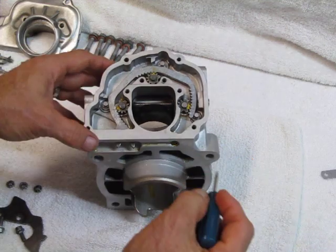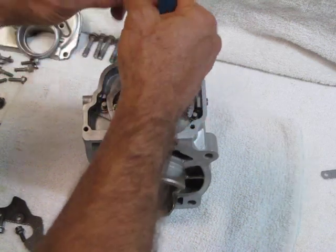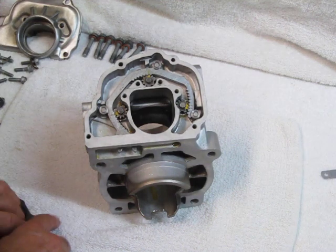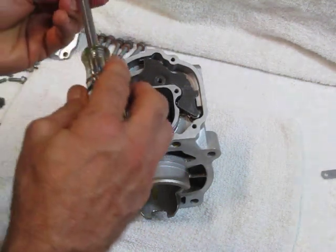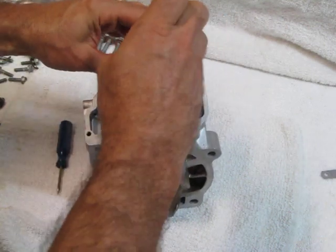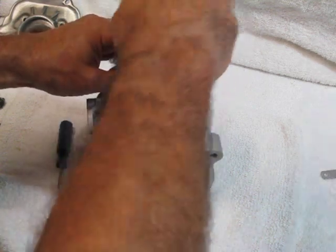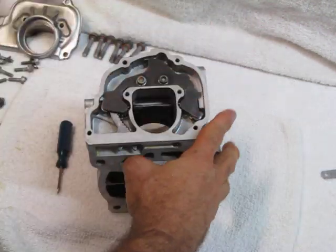Roller guides are still down there in place. Now we're going to take three more roller guides and put them right on top here. Everything is still lined up like it's supposed to be, and now we will take the guide plate, drop the guide plate in here like this, and we'll put the five millimeter screws in place. When I do this for the final assembly, I'll use the Loctite 242, but for demonstration purposes here we're just going to snug them up a little bit by hand.